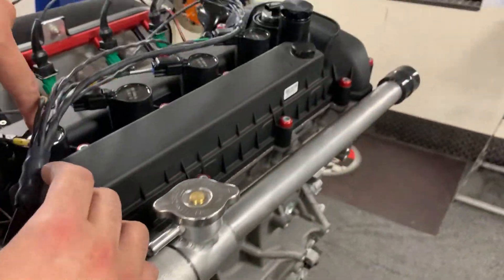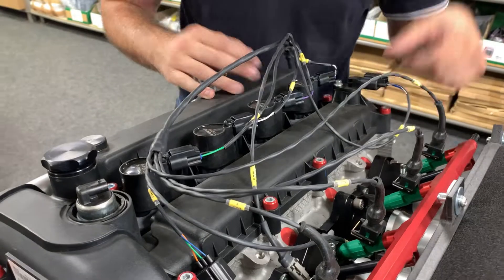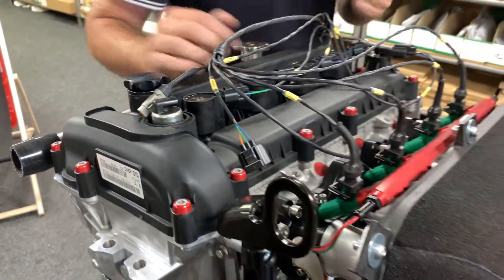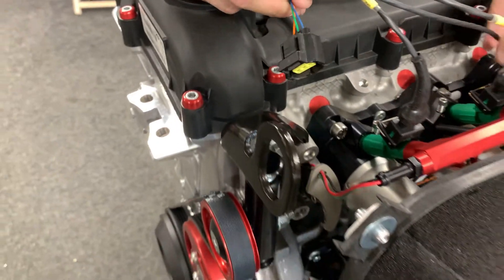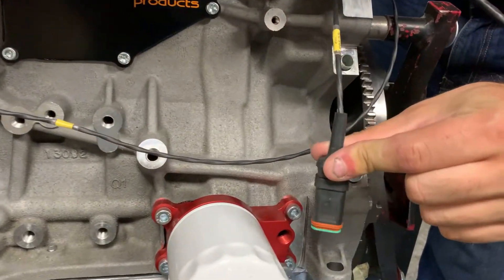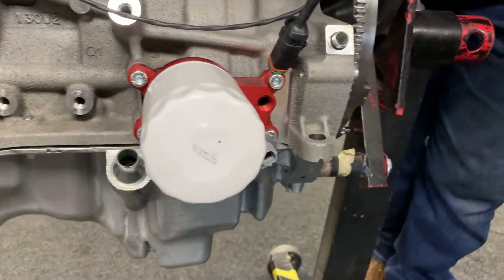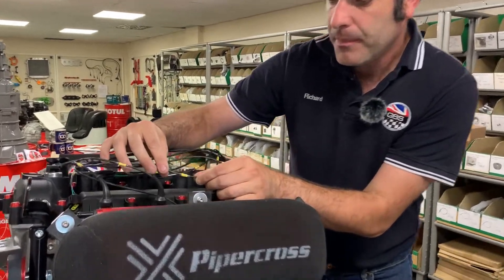Going on to the top, we've got our coils — it's a coil-on-plug engine with four coils in the loom. You've got your cam phase sensor on the back there, and your VVT solenoid, which is your PWM signal for controlling the variable valve timing. We've got each injector, a temperature sensor in the back plate for your air temperature, and your connection at the front for your throttle position sensor. Lower down on the engine we have our alternator wiring and our oil pressure sensor, suited to the Smiths Variohm type sensor. Everything's labelled up so each part of the loom has its labels — you know exactly what goes where and can't get it wrong.